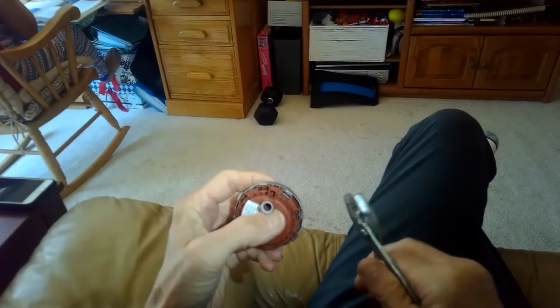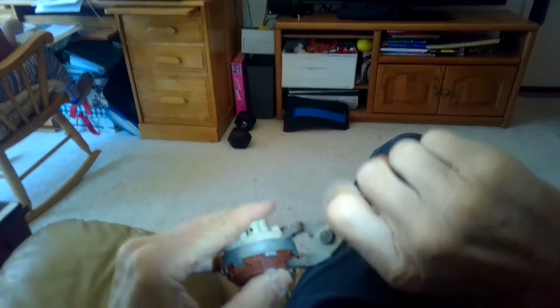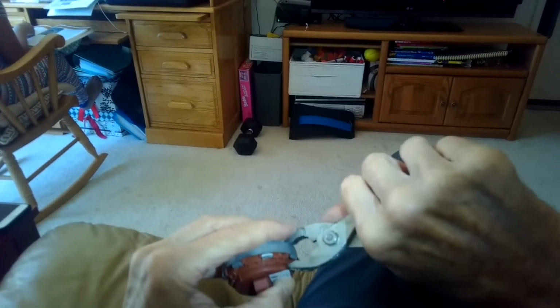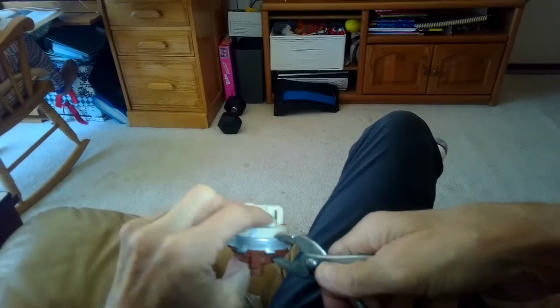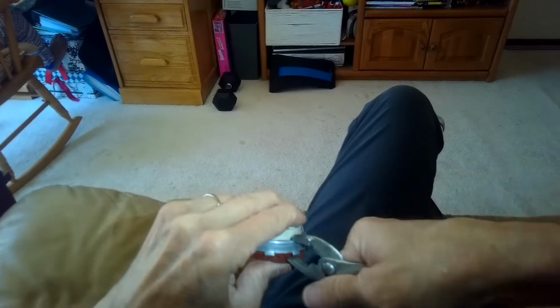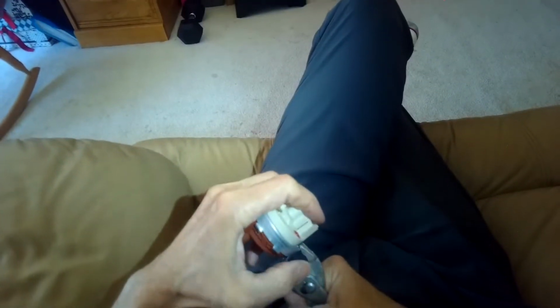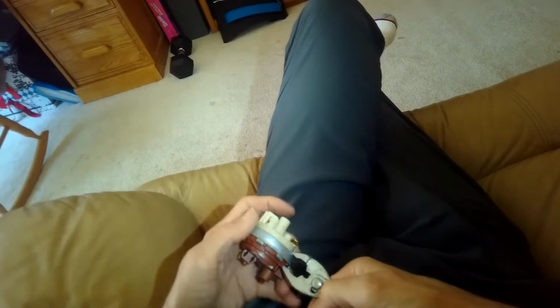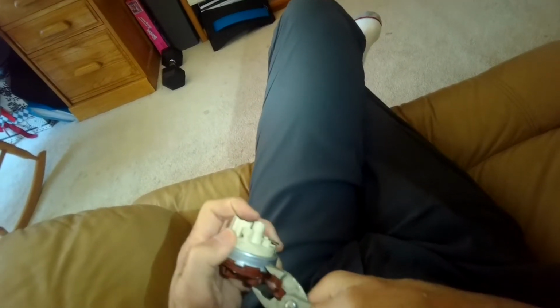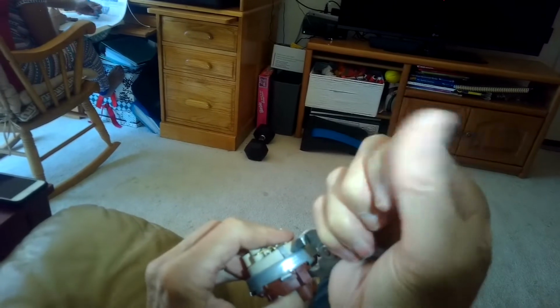We're just putting this ring back on, and we're going to just give it a little compression with the pliers, and that's going to make that rubber membrane nice and watertight again. We have to squish these down, and we have to bend the prongs in. Make sure they're all coming down far enough. That ring, once you bend those prongs in, is what's really helping to create that watertight seal. You do have to get these in nice and tight before you bend those back.